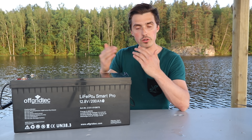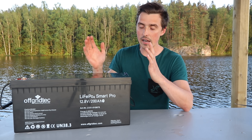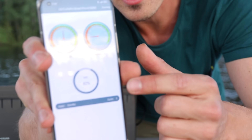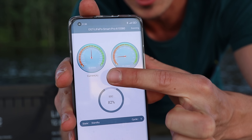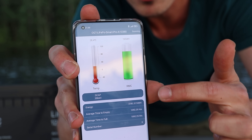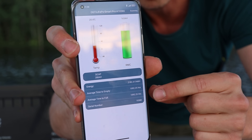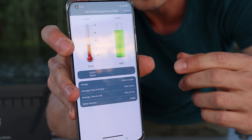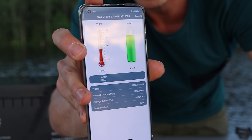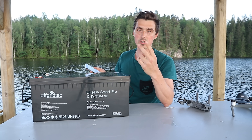They have a Bluetooth app so you can monitor how much battery you use, and it actually works — which is a world's first. They are sponsored. You can see 82% state of charge, the voltage, the amp draw when the motor is running — this motor is 110 amps maximum, that's 2.5 kilowatts. You can swipe to see temperature, amperage, amp-hours left. At 100% motor power, time-to-empty goes down to about one and a half to two hours on both batteries — pretty insane.